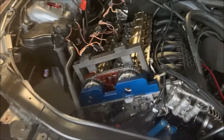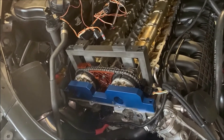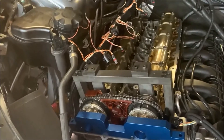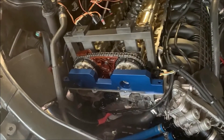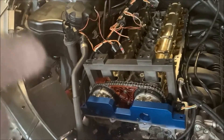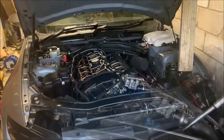I've done two rotations of the crank — that's one full rotation of each cam — and I've refitted the tools with the locking pin down in the flywheel. Fingers crossed we're now all timed up; everything's sliding in nicely. All that's left is to take out the pre-tensioning special tool, put in the actual tensioner, and then reassemble.